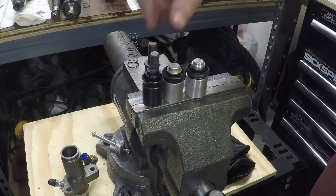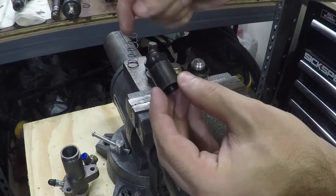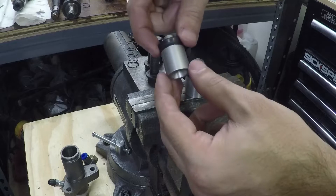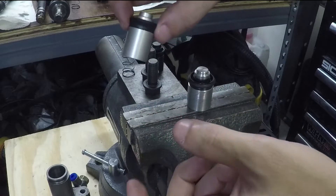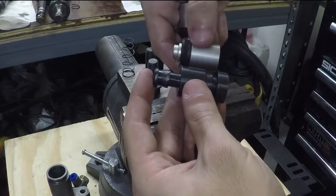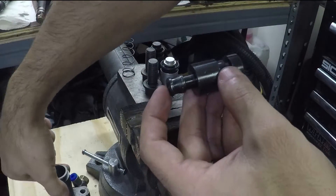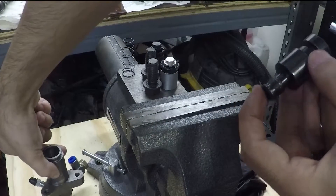Taking a quick look here — we have the stock replacement cylinder, which is three-quarter inch, which is too small. So we decided to upgrade to the 13/16 inch, which helped but didn't help enough. We might revert back depending on how the clutch feels. Then we have this custom one that we made. We ended up buying a 7/8 inch one, which is way too long and is also made of steel — I wasn't sure how the response would feel — and it wouldn't fit inside the slave cylinder very well since it takes up pretty much all the length, so you wouldn't get the full stroke.